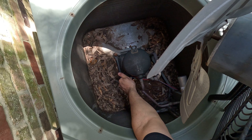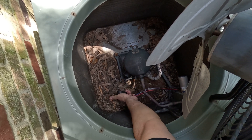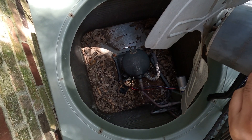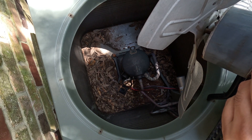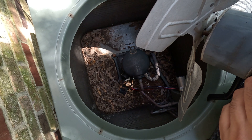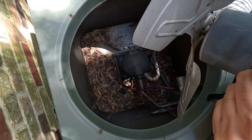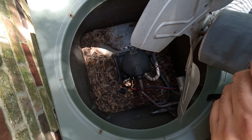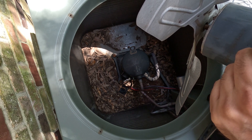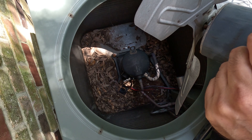You're going to take the plug off — the plug for your compressor. By taking off the plug, you're isolating and removing the compressor from the actual circuit. Now restart your unit and see if it trips the breaker. If your unit doesn't trip after you took that plug off, I'm about 99% sure the compressor was your problem. That's the easy way to diagnose your compressor if it's blowing breakers.